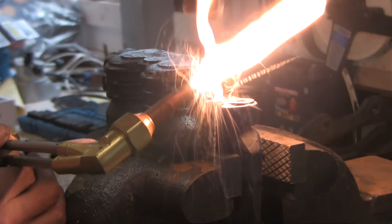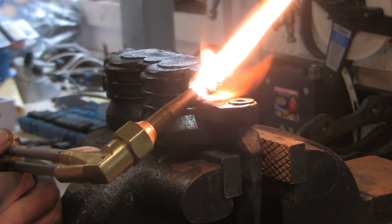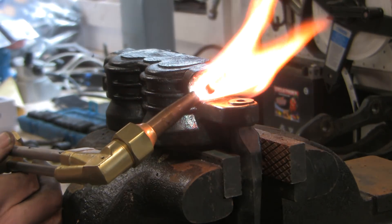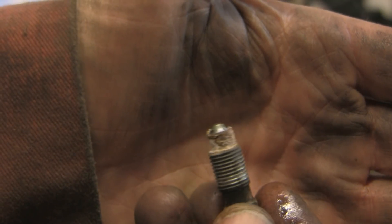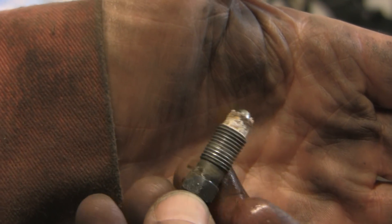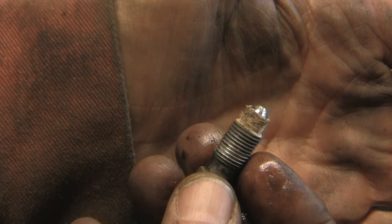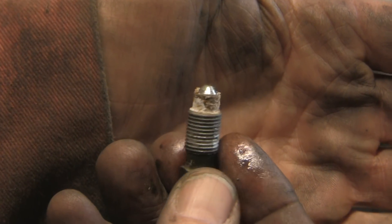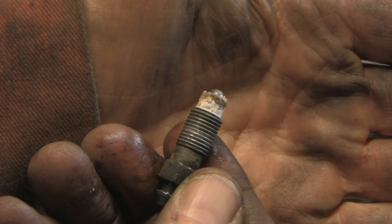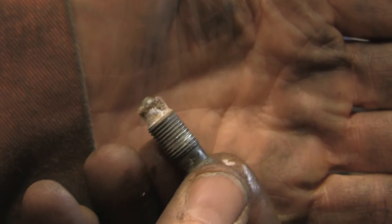I'm using a cutting torch here, but in retrospect I should have switched to a smaller brazing tip to more carefully direct heat at the base of the bleeder, keeping heat away from the vulnerable bleeder tip. I get frustrated when I see bleeder screws without plastic end caps. Look at this bleeder screw — notice how much corrosion there is on the deep end. This bleeder had no cap, so moisture penetrated through the end hole and eventually formed a calcified blob that completely obstructed the hole leading to the tip. Even if you get this bleeder screw out it's never going to work until you clean out the passageways on the bench.